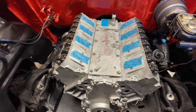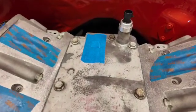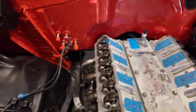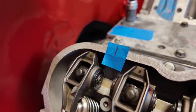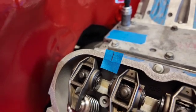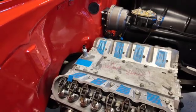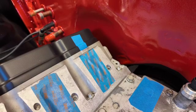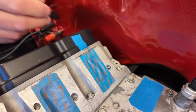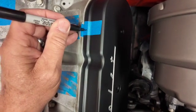The engine is mocked into place. I added a piece of blue tape on the back of the valley cover, and with the valve covers off I added a tape line marking the space between the rockers — I don't want anything sticking through the valve cover that could hit a rocker. I've marked both sides so I can get a good measurement. Now with the valve covers on loosely, I transfer the marks over to each valve cover using a Sharpie on both the driver's and passenger's sides.